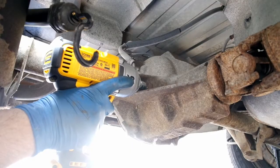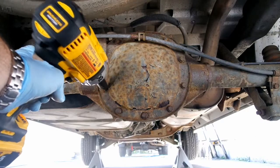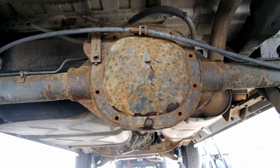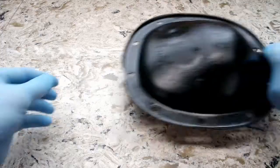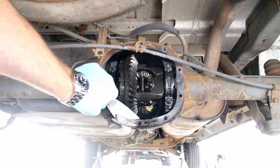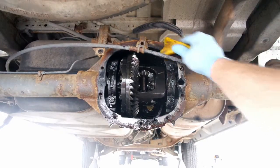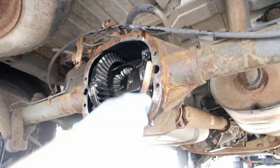For the rear differential, remove the fill plug with a 3/8 square drive. You will probably need some extra persuasion for the fill plug. Remove the differential housing bolts with your preferred implement. When bolts are removed, crack the cover with a pry tool of some kind and let the fluid drain, then remove the cover. Now is the perfect time to clean up and paint your differential cover. Make sure the seating surface is completely clean or the gasket will not seal. Scrape the old gasket and any residue from the axle side — putty knives or razor blades will work fine.